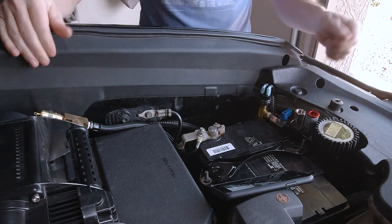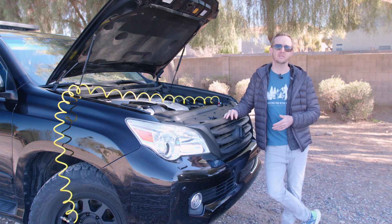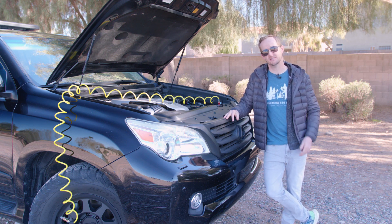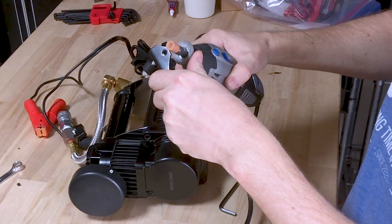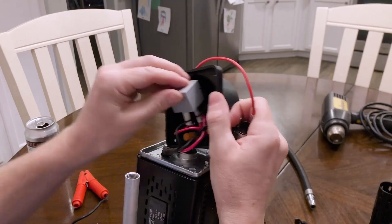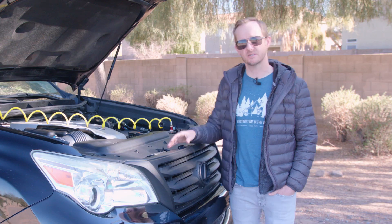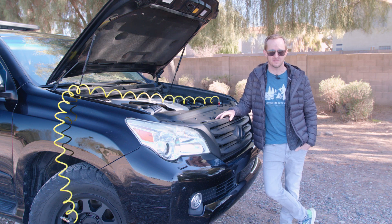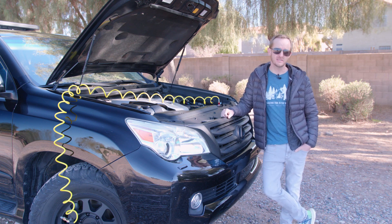There are a lot of things to love about a setup like this. It's super clean, the components are in all the right places, and the usability is well thought out. It's also a great value at around $350 for the entire system, compressor included. However, this isn't a totally bolt-on project — you'll need to modify a few parts like the compressor and manifold brackets, as well as crack the compressor open to add the pressure switch leads. Thankfully, I think I've made most of the mistakes for you, and there is a comprehensive parts list in the project description below. I hope you enjoyed seeing how I built out the poor man's Land Cruiser's onboard air system. If you enjoyed this video, please hit subscribe and share it with all your camping and overlanding buddies. I'll see you out there.